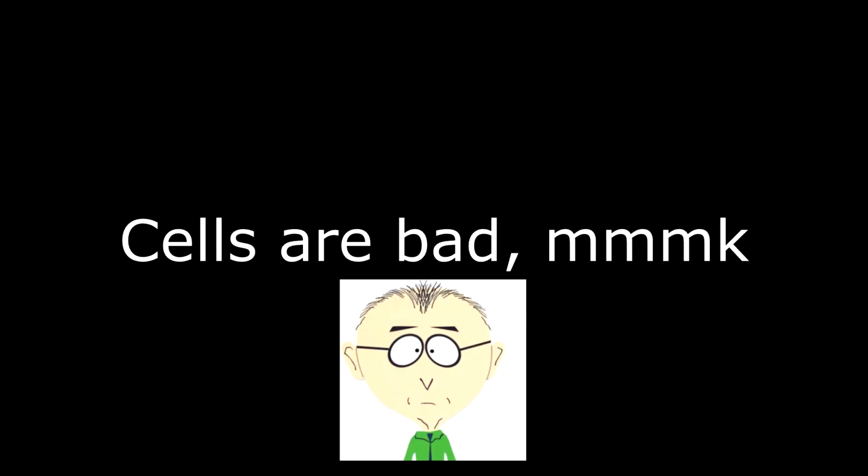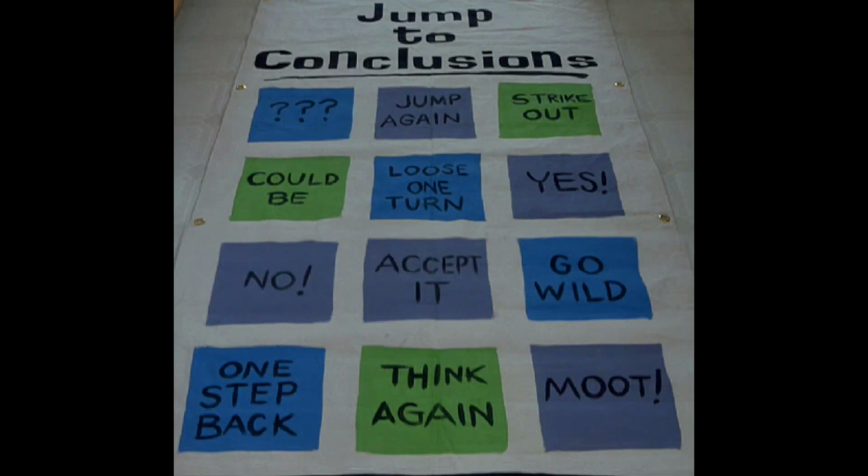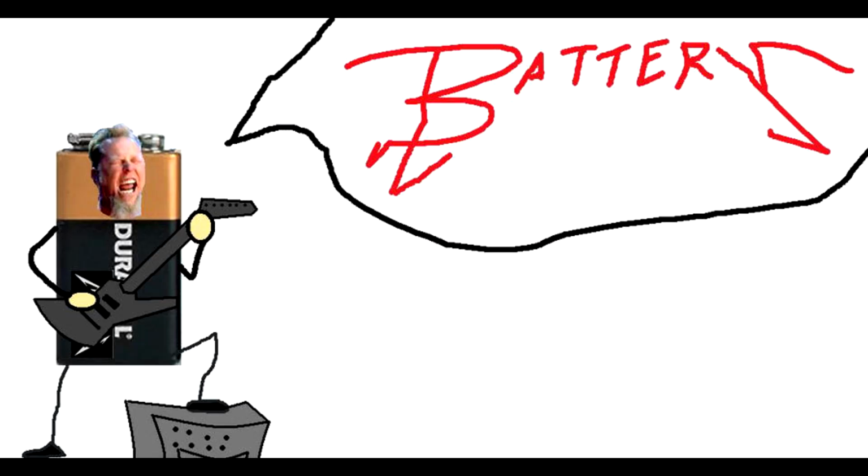So where the difference might come in is if we have a very large current draw where all of the cells are going to be strained, that might be the difference in showing that. But it would be worth investigating the cell that drops off, maybe charge that individually and just let it sit. We know if it just falls off sitting there, it is definitely a bad cell. So we have a little bit of inconclusive data from that particular test with these cells, but when you're doing it with a battery, you're probably going to get a more decisive result, as I have seen historically.